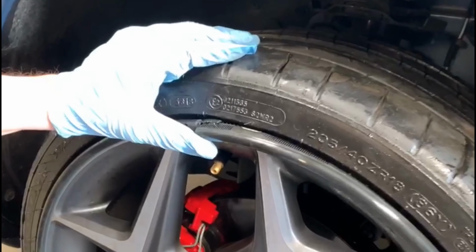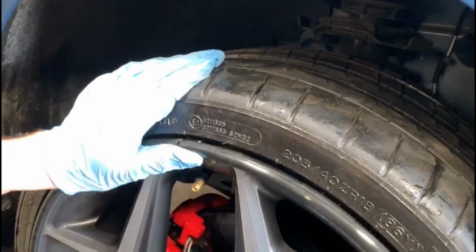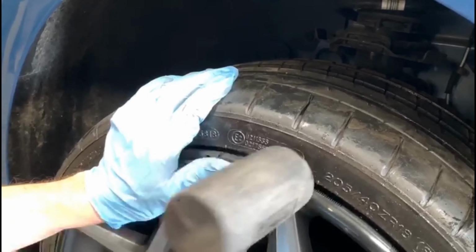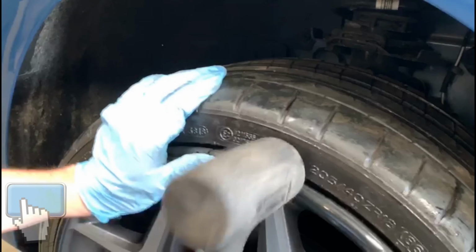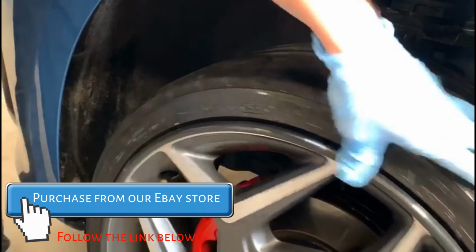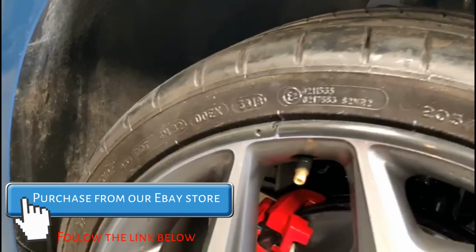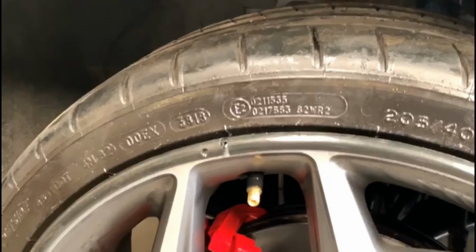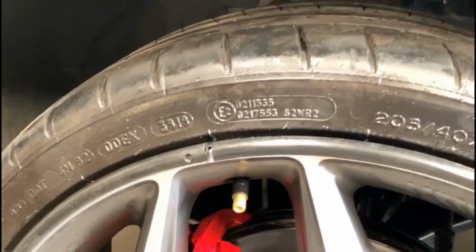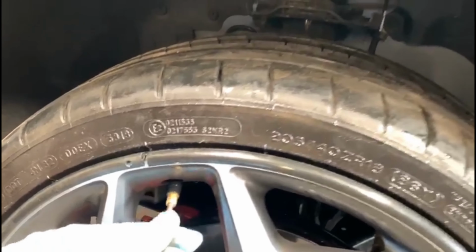Okay, so you've got a small amount of glue in there, and then as that pushes into the teeth, that will help secure it. Yep, and then the last bit. You have to make sure you get into the toothed bit there. Okay, and then the last little tap in. Then what we do is we re-inflate the tyre to about 15 psi. The gap we leave where the join is, as you can just see there, the cover will cover over the top of that. Yeah, so then we'll glue the joining clip on at the end and that'll cover that over.